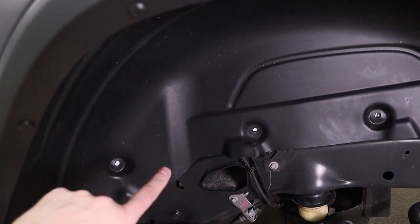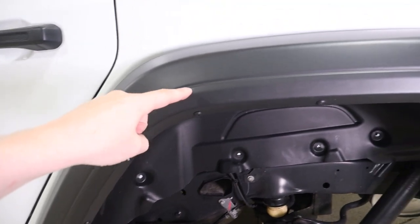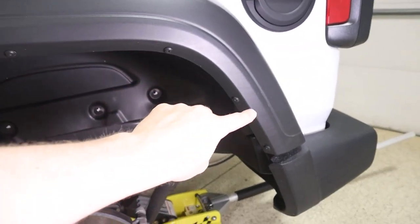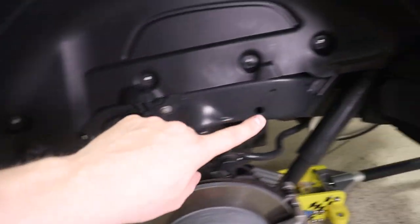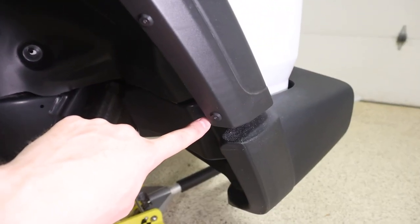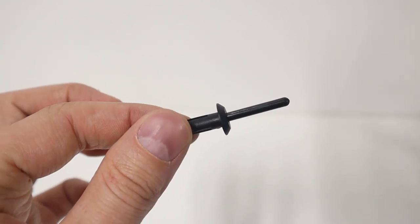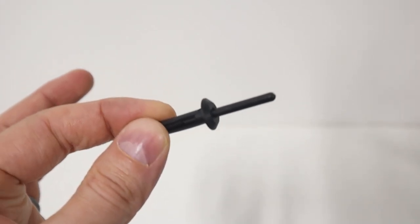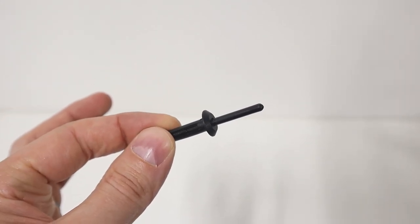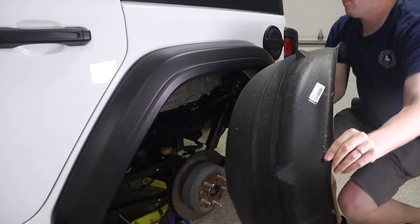With those clips removed, we now need to cut out the plastic rivets. There are eight total, but we only need to remove the innermost six — we do not need to disconnect the outer one on each end. To do this we use a utility knife between the inner fender liner and the plastic fender trim. We don't need to worry about destroying these plastic rivets as JL Audio has given us new ones. With all the clips removed, we can flex the inner fender liner and remove it from the vehicle.